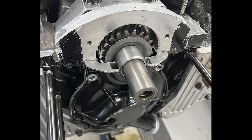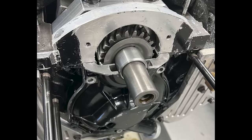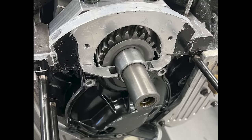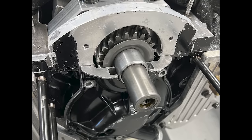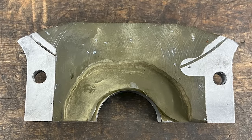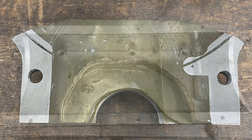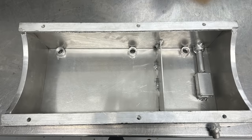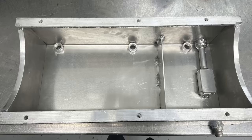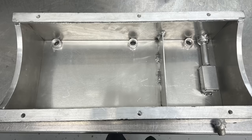Here's a look at the front of the engine so you can see how the retainer plate adapts with the timing cover. The timing cover has been cut into two pieces — the upper half has been bolted up, and from the scratches in the paint you can tell the Dortons have had this engine together and apart more than a few times as they've refined their design. To seal against the aluminum adapter, the lower half of the timing cover is filled with epoxy and then milled flat; a little silicone eliminates the chance of any oil weeping past. Here's the 100% custom-fabbed oil pan for the build — the original oil pan would never mount up with those lateral main cap supports in the way.